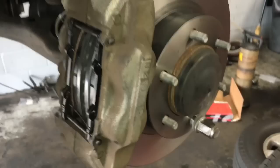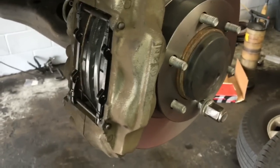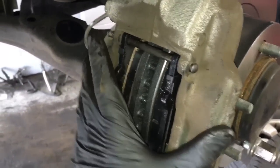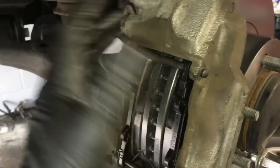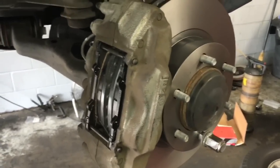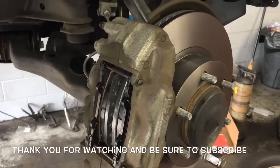Now you're ready to take your lug nut back off and put your wheel on. Torque the wheel down, then duplicate the same process on the opposite side. Once you've done both sides, put the wheels back on and lower the vehicle down. Pump the brake pedal until all the fluid is pumped back into the calipers. Once that's achieved you should have a nice firm brake pedal and you should not have to bleed the brakes. But if after pumping the brake pedal seven or eight times it's still spongy, somehow you've got air in the system and you'll have to crack the bleeder screws and have somebody help you bleed the brakes. That pretty much completes the front brake pad and rotor replacement on a 2008 Toyota 4Runner. I'm Brian Essek from How To Automotive — thank you for watching, and I encourage you to subscribe for more valuable videos.